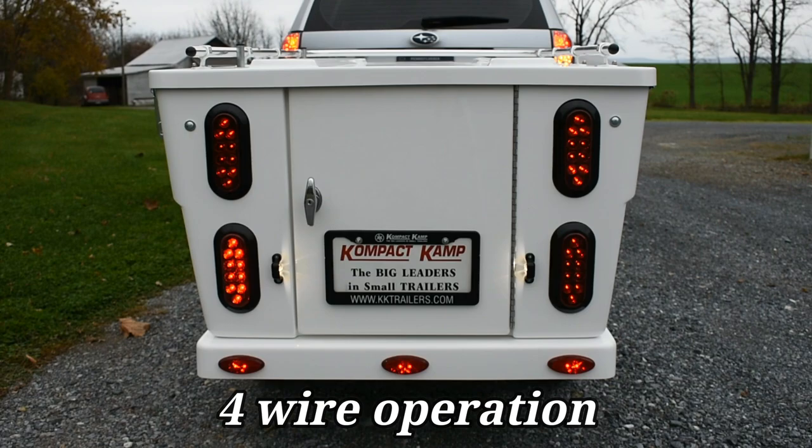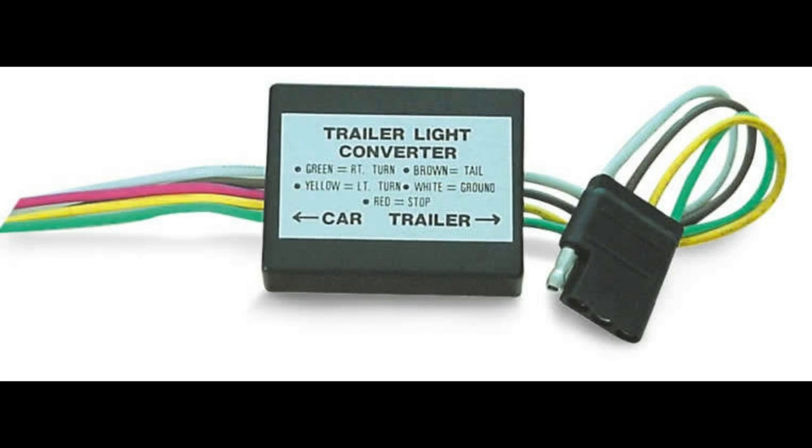Now even though nearly all vehicles are a five wire system, it's very common and standard for cars and trucks to only have a four wire trailer harness. Here you see a trailer harness for a traditional car or truck. You have five wires on the left that connect to the car, then you have a converter box and out of that comes only the four wires into your flat 4 plug. You can see that they've eliminated the red wire, which is designated for stop, and that converter combines the stop lights into the turn signals.